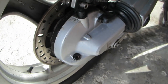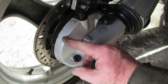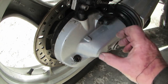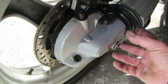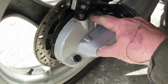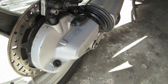Now in the rear diff on these bikes you have a bearing here, a taper roller bearing which holds the crown wheel, and then a big ordinary roller bearing on the back of the crown wheel which is shimmed to give the right preload to the bearings. Now if they fail it's a diff rebuild, which is a bit involved - not the end of the world but not something you can do on a Sunday afternoon with no bits and no tools. So if it's the Paralever bearings you can easily do them and I'll show you how.